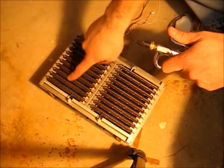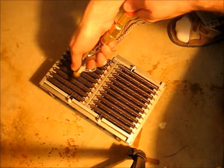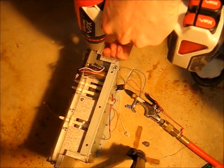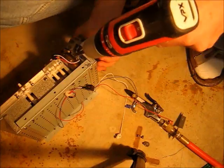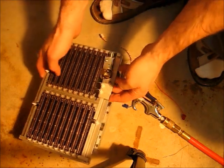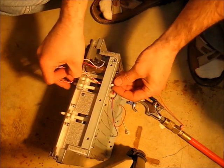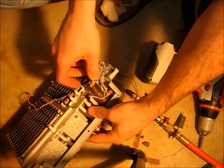Use compressed air and blow back down through all these burner ribbons. If you don't have an air compressor, you can buy canned air at the hardware store. Remove one screw here, one on the top, and one more screw right in there. Next, we have to remove this ODS. To do that, flip it over — red and white wires have a grommet on them. Kind of push that through and pull it all the way out. Take one screw off the bottom, and then we can pull this ODS out.